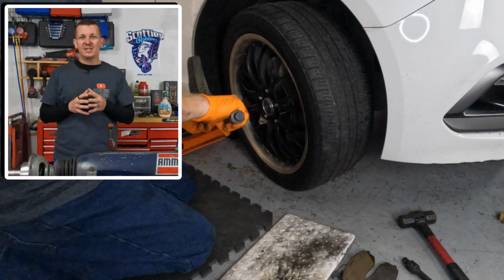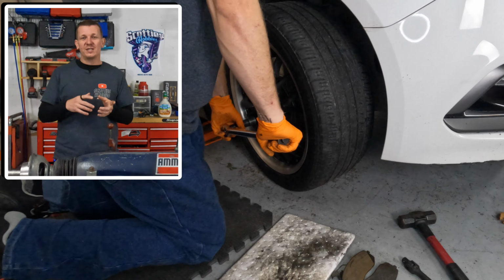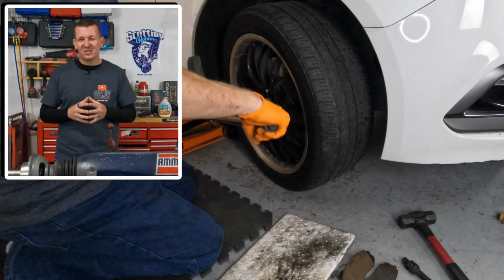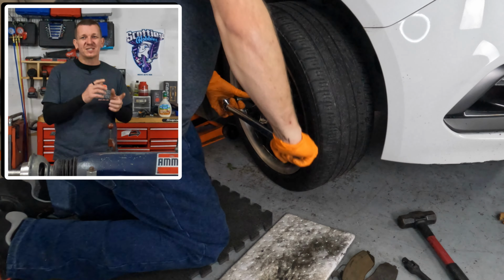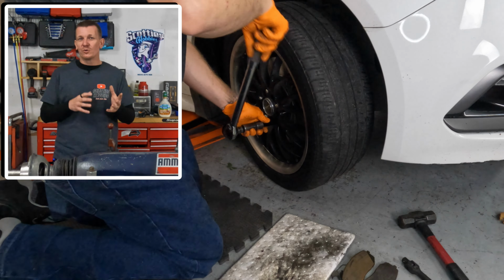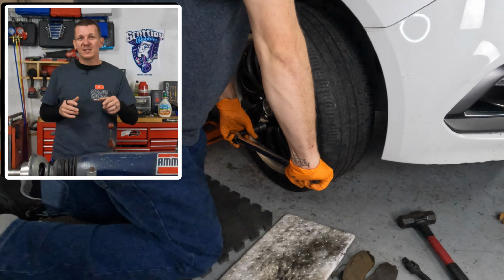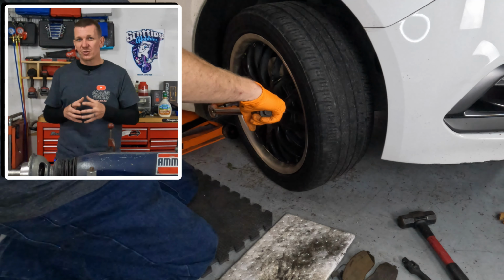In 2018, the lug nuts do get tightened up a little bit more. The 2018 to 2021 year models, these lug nuts are tightened up in a window of 79 to 94 foot-pounds. A little bit tighter than the older year models, but again, 79 to 94 foot-pounds, tightened up in a star or cross pattern, never in a circle pattern.